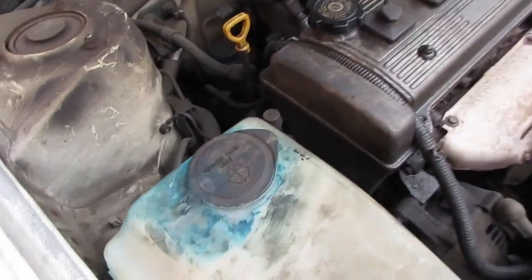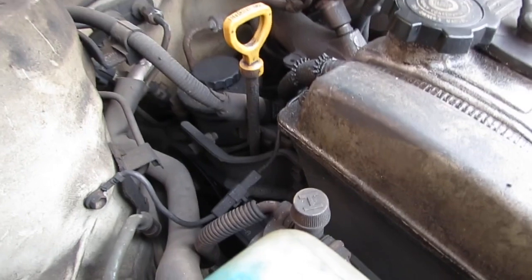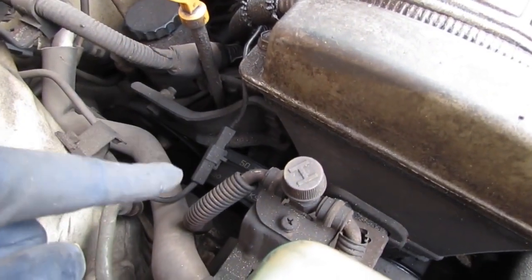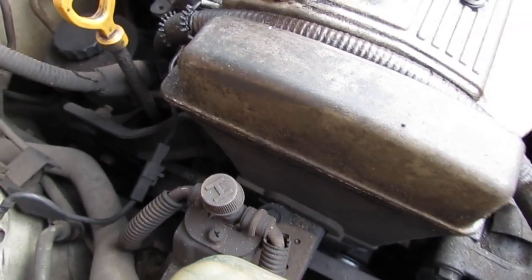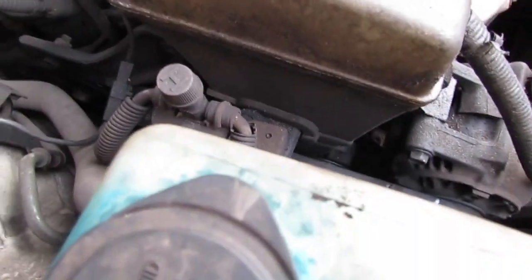So you hear that change in the high-pitched sound? That sound right there is an indicator that when you get load on the system, it taxes the belts. And that's why I'm pretty sure that the belt and the idler pulley are going to be the source of failure on this. And you want to replace them just because of the structure of the system.